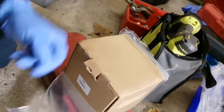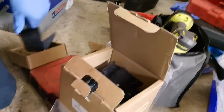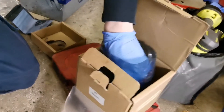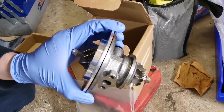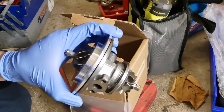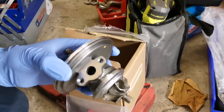It came very well packaged — I actually bought it on eBay. One of the nice things it comes with is a balancing report, a graph just to tell you what the vibrations were at specific RPM. They spin it up to 150,000 RPM, which seems insanely fast, but you have to remember that this is basically the makings of a small turbine engine. You've got a compressor and you've got a turbine. It just so happens that the combustion section is the diesel engine in this instance, whereas it would be a separate combustor in a gas turbine engine. But it compresses the air, you increase the compression, add your fuel, you burn the fuel, and the turbine extracts the energy from that heat and turns it into kinetic energy — turns the shaft, which turns the compressor. So that's the principles of a turbine engine, and it's also the principles of a turbo.